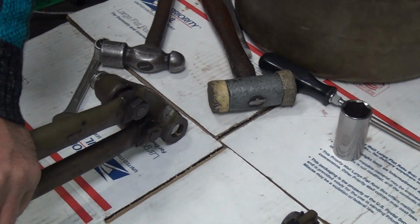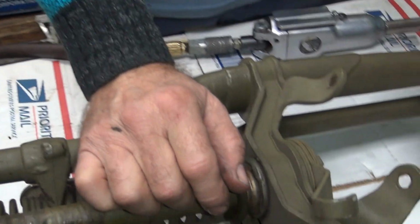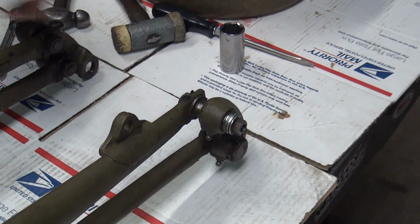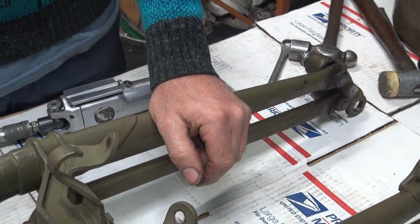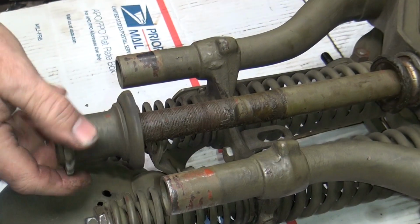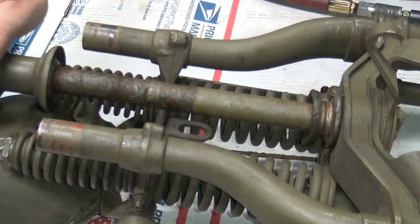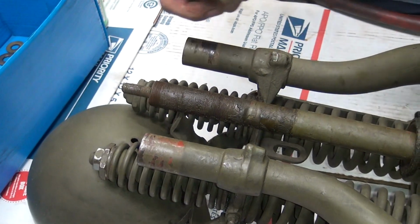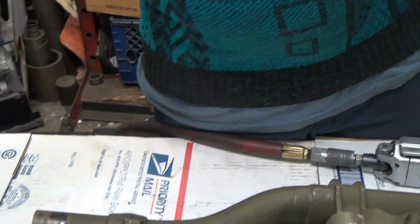That's why both your wheels over there are the same. Right. Otherwise you'd have a conical hub front wheel with a 45. So only the WLCs, the trikes, and the big twins have the big rockers. And also the WLA, the front wheel was different than the rear, correct? They were not interchangeable. The conical hub. Now the big twin stem nut is only about this tall up here, so that's how you can identify these real quick. Besides just the diameter, when you look at them, the big twin one's only like that tall. So you can see them real quick.